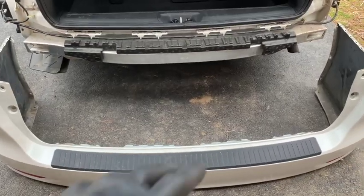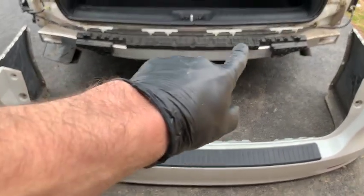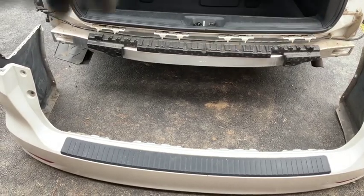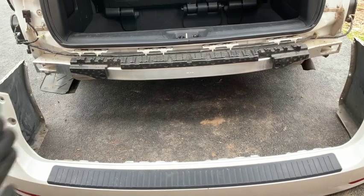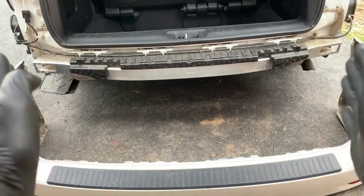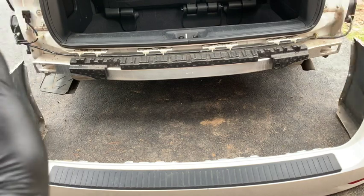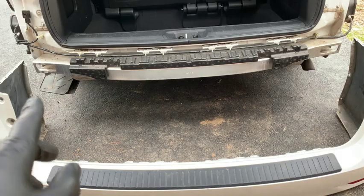What we're going to do is pick up on the middle of the bumper and set it on the bumper beam absorber, which is that black part on top of the bumper beam. When you're doing that, you want to make sure the sides stay on the outside of the car. Go back and forth so the sides don't hit the back and get scratched.